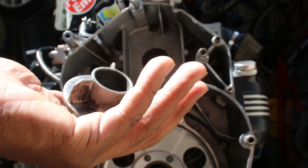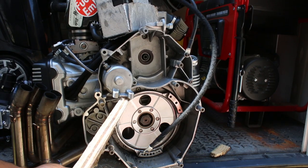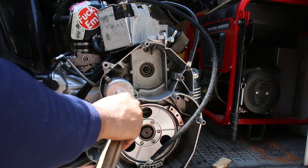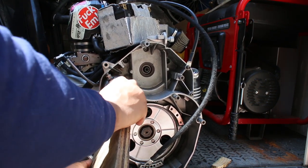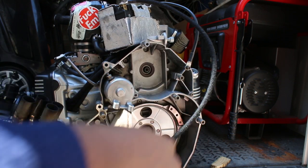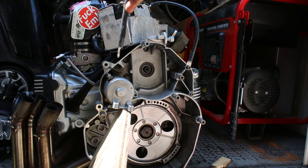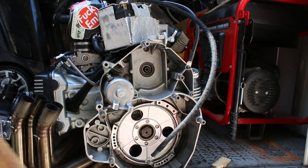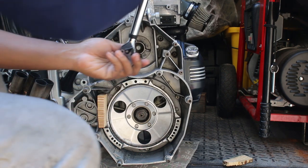When I was putting reverse torque on the engine to remove the dog, the sprags must have righted themselves. I wasn't fully convinced so I went ahead and installed the starter motor. The transmission wasn't attached to the engine so I had to prop the starter in place with an even bigger piece of wood so it didn't spin its own body around. I attached the negative to the bellhousing to ground the starter since it's internally grounded to the engine. To power it I just touched a positive to the screw terminal on the starter. Boom — engagement. What would happen before is that the starter would just spin but the engine wouldn't. Now while I reinstall the dog, let me explain the gamble that was the starter sprags.